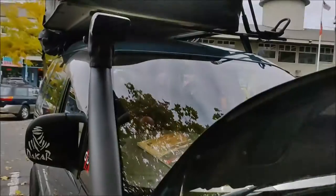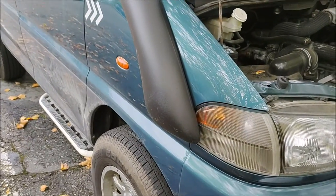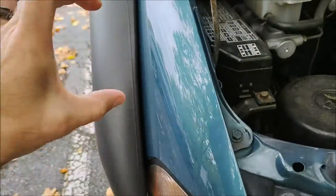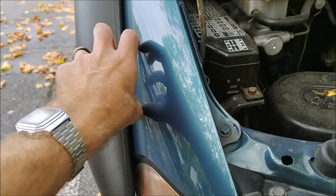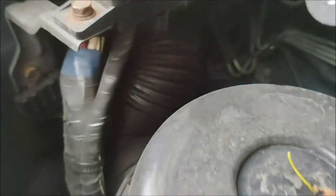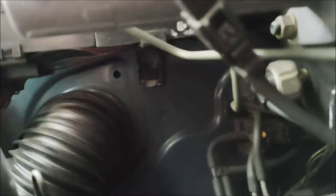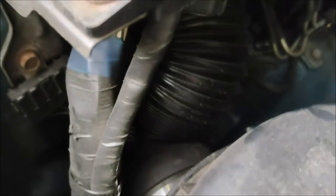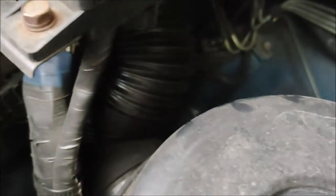So the last video you saw there was about four months ago, and that was drilling a hole in the side of the fender. That corresponded to this snorkel, which is flush except for one 75 millimeter plastic extension circular that comes off — and that's what goes through the fender. Now the kit comes with this flexible ducting here. As you can see, we're using the stock air box. The ducting connects right here on the bottom of the air box, flexes up, and it goes right there through where the stock plastic air hose rigid would have mounted. Now this makes for some pretty tight bends. I'm a little worried about this material in the long run with some super tight bends, but it has been four months and it still looks great, so I would say that worked well.